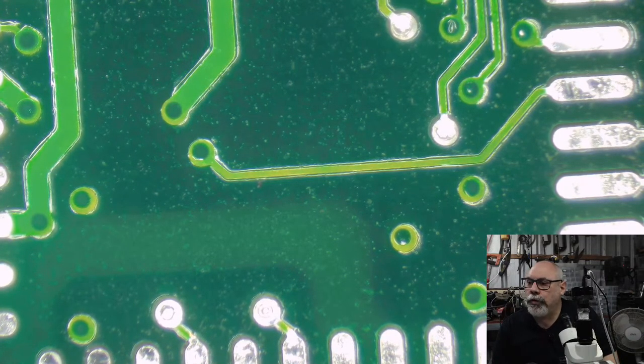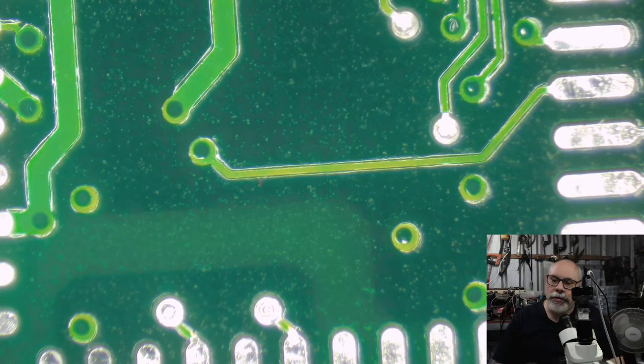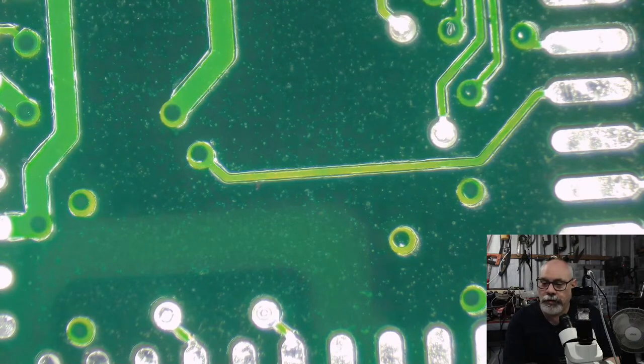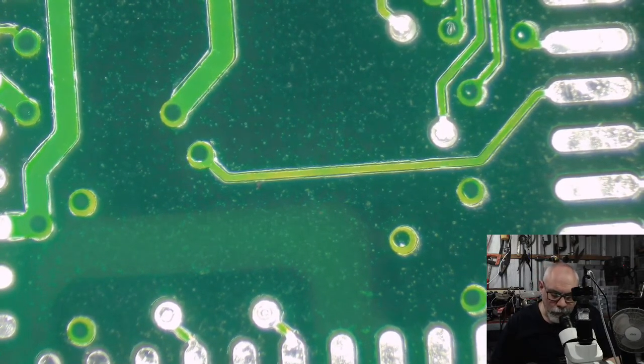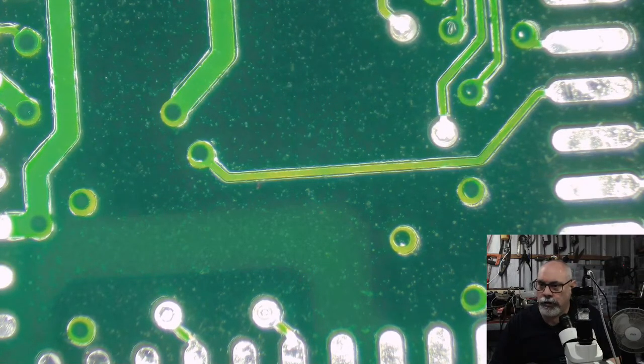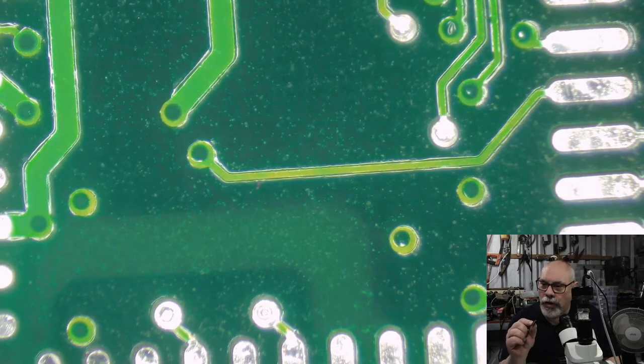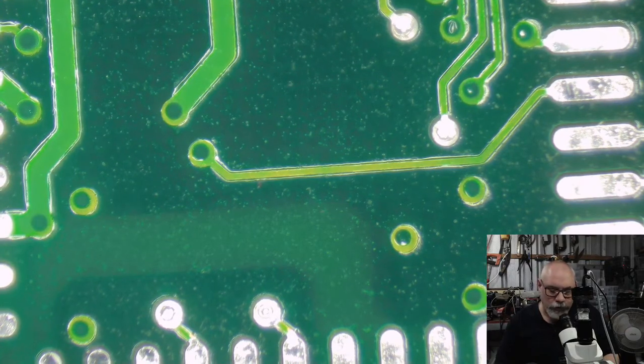Is there some damage to the logic boards when using hot air to remove the SMT electrolytic capacitors? There is the potential of damage. Now, generally, if you're just removing these sorts of plastic chips, this is a PLCC chip, plastic leaded chip carrier, these are generally fine. I've removed and put these on and I've hit them with hot air and they generally don't die. But having said that, with a lot of the really old Macs that I work on, I will often shield the heat. Because I do worry, even if it's not going to do damage to the chip itself, it might do damage to the, sometimes they get really crusty solder on them and then that can weaken the joints. And if I don't want to have to go in and re-solder the component, then I have to be very careful. But generally, because these are a carrier and the chip itself inside is a teeny little thing inside it, these are pretty resistant to heat.